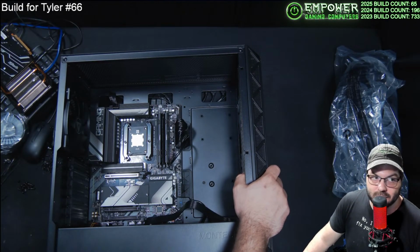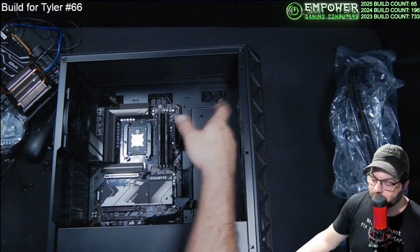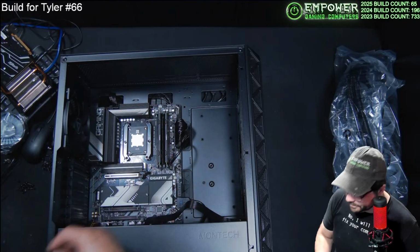So go to that link on another computer and then locate the Wi-Fi driver for that motherboard. Download it, put it on a USB drive, and then plug it into your new system and run and install the download.